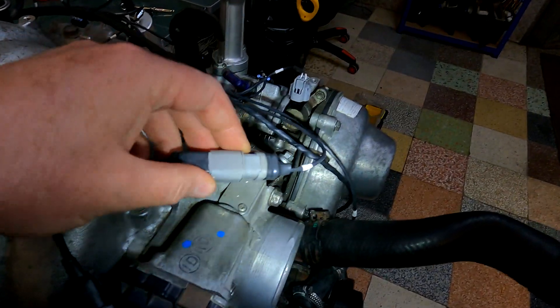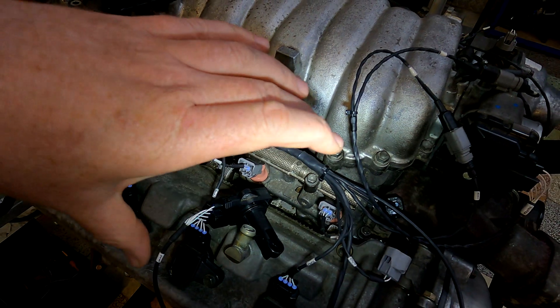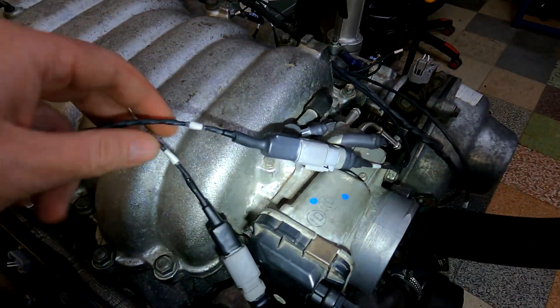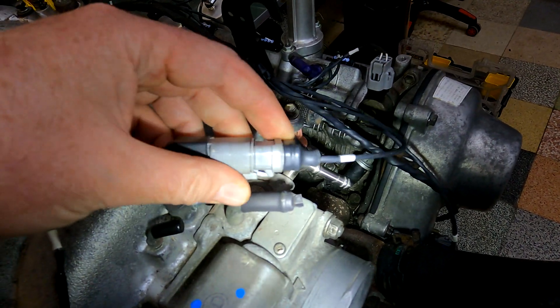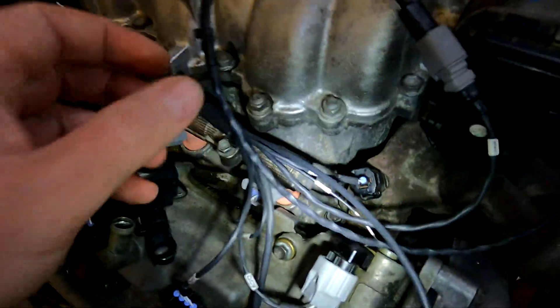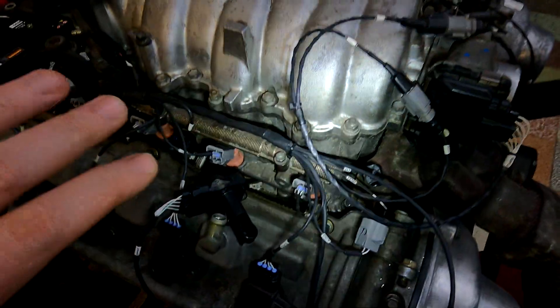Because he's going to extend his throttle to actually come out here — if you guys have seen the Speed Academy videos, he's using the same setup as them, so the throttle is going to come out over here. What we've basically done is made a little extension harness. We changed the TPS connector over to a 4-pin DTM and the drive-by-wire motor connector over to a 2-pin DTM, giving a bit of extra length so he can move the throttle over to this side.